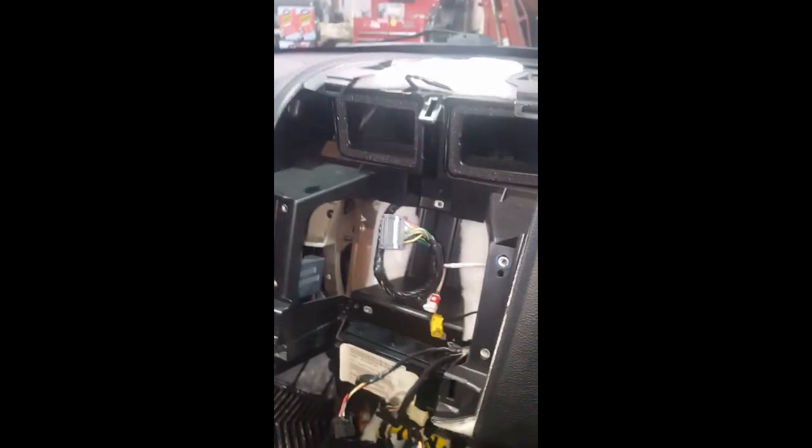I'm just laying the stuff back in the back seat. I pulled the handle up all the way, lifted the back of it, and got it out of the way. You can see I've still got a lot more disconnecting to do before I get this whole dash out so I can get the box out to replace the heater core. Pull the screws out to remove this piece that clips in — there are some wires there. Get that out of the way; this piece just clips in.